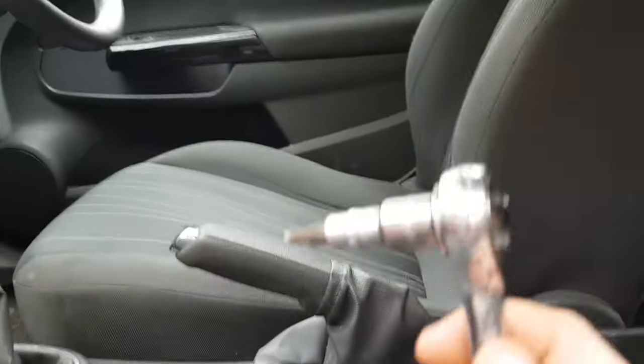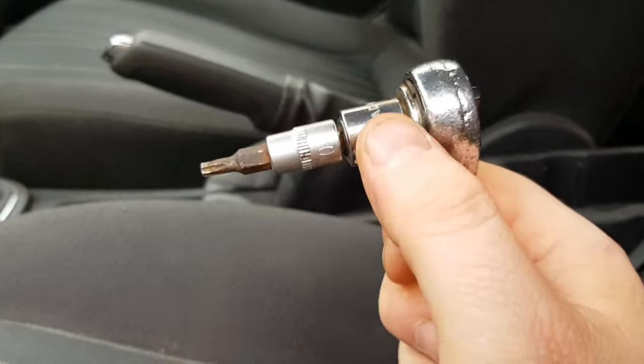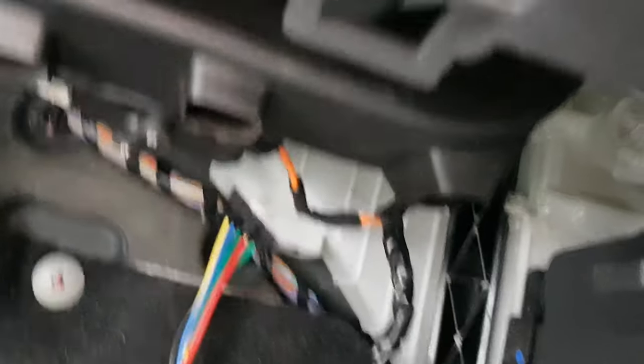It's never going to be easy — it's going to be awkward. Your first Torx is a quarter inch drive, and nobody has a quarter inch ratchet anymore, so get your three-eighths to quarter inch reducer and put it on your ratchet. The screws: open the glove box, there's one in each of the two top corners, and two underneath at roughly the same spacing — one there and one there. I'm going to loosen the bottom ones first so the glove box doesn't fall and crack the ones underneath.